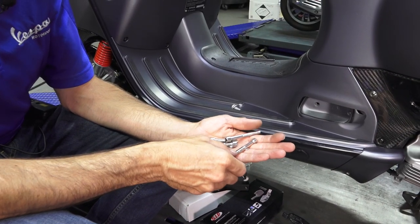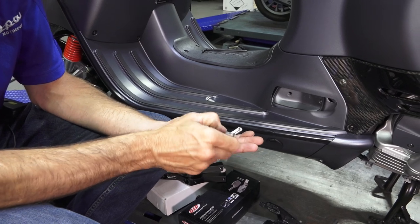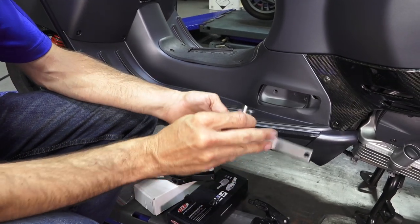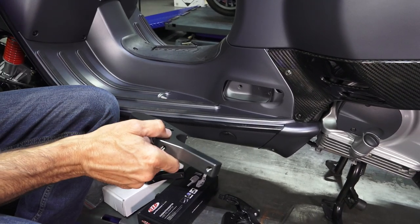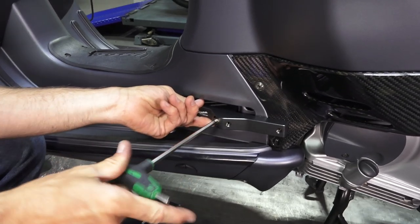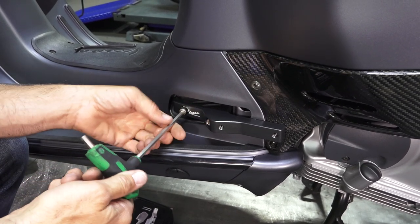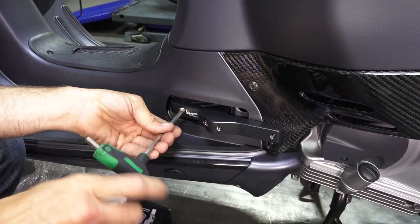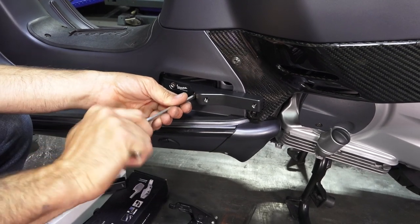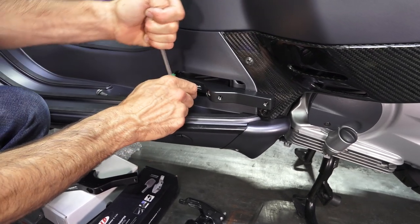So you have a set of hardware here — stainless steel Allen bolts. You're going to need one long one and one short one for each side. You're going to need a six millimeter Allen key to install these. The long one goes towards the rear and the short fastener goes towards the front. Go ahead and pre-install those. Get your six millimeter Allen and just feel your way around and get them started. The angle is pretty critical. Don't tighten one fully first — you want to get them both started, as with any fastener, otherwise you may have a misalignment issue. Go ahead and tighten those back and forth. You can snug those pretty tight — they are eight millimeter fasteners. Very solid.